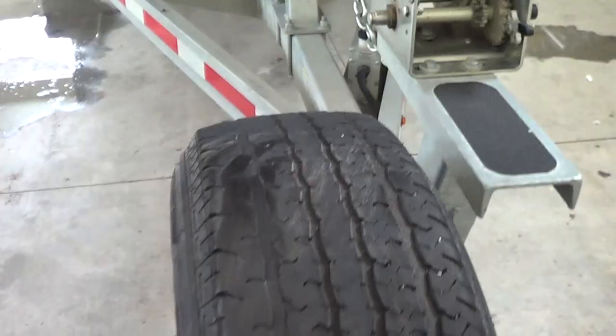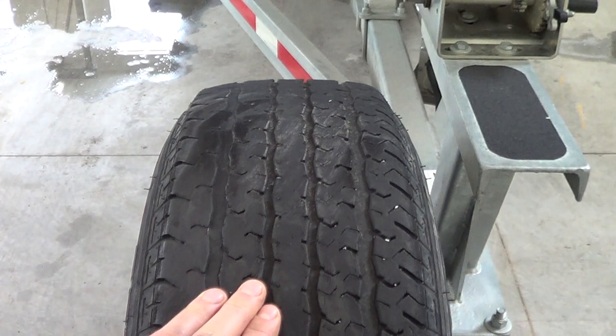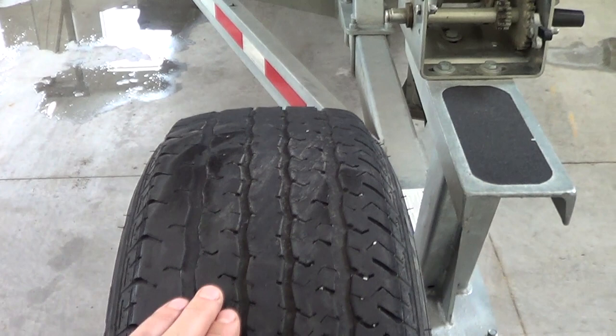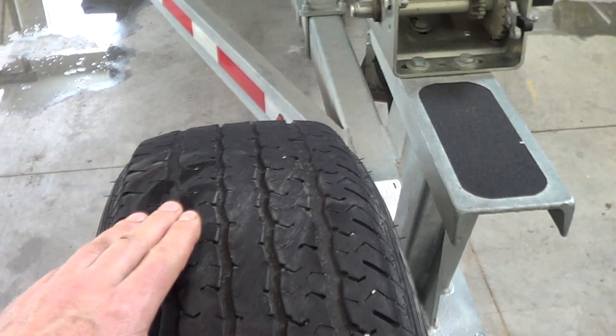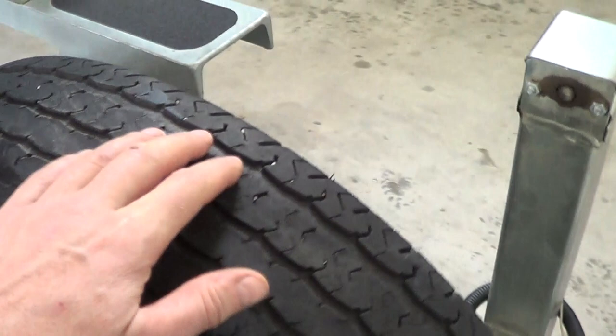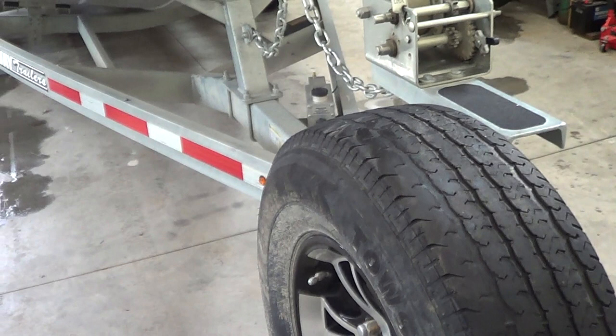Here is the tread on what is now the spare tire. The most I've driven this trailer is 20,000 miles; a more reasonable guess would be about 14,000, but let's work with 20,000. I used up the spare, and the tire it was replacing was worn about like this — the tread on one side is pretty much gone. I used up the spare and replaced four additional tires, so altogether this trailer has gone through five tires to get 20,000 miles, and now has maybe half the tread gone on the remaining tires.